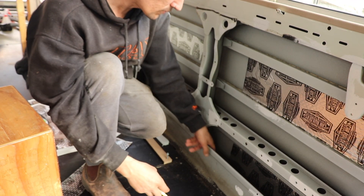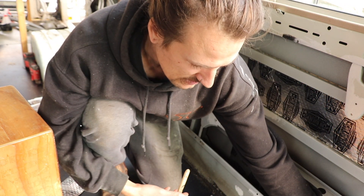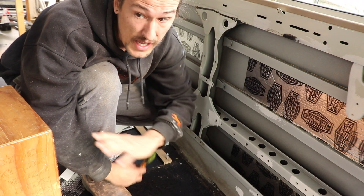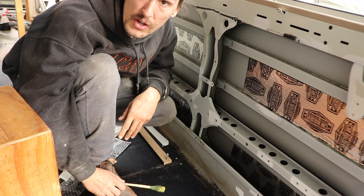While Chelsea's sanding everything outside, I'm going to fish oil down in any of the seams before we put the insulation in. This is just Omega fish oil — put it in with a brush or tip it in and run it all along the cracks and seams, anywhere that's hard to reach. If any moisture gets down there it won't rust, and if there is any rust it won't rust any further. For the most part this bus is very clean of rust, so pretty stoked with that.